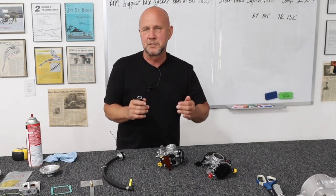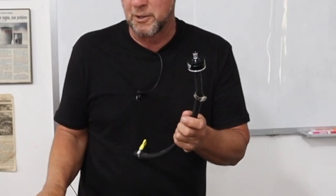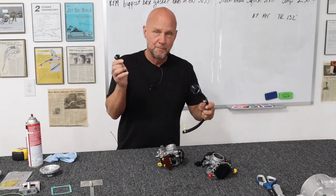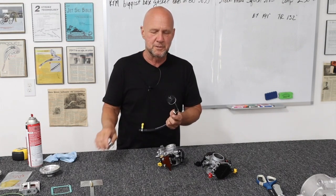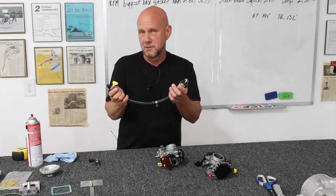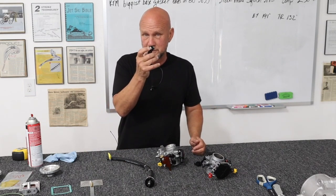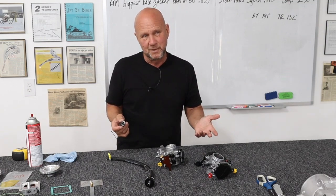In this case, it was the other thing causing the bike to run out of fuel. I knew that because I switched over to our little clamp-on-style filter, which just eliminates this part of the quick disconnect. By eliminating this plunger system and just using the clamp-on filter — where it's just hose in both places and you're using those clamps to put it together — that solved the leaning out. I did try the metal ones of these things, because I know people like that. Maybe it had a different plunger system, maybe it was a little bigger. Ironically, it was worse — it sure wasn't better.